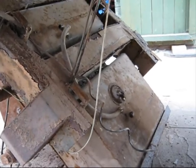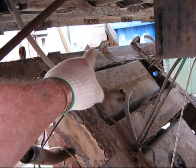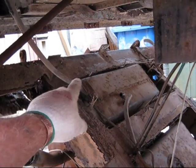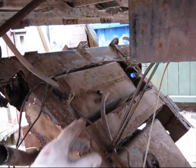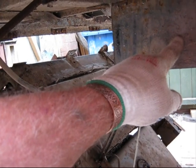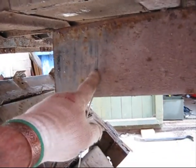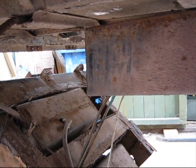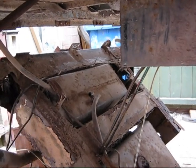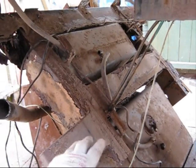But there you see, if I'd have done this differently, I'd have cut the chassis first and then nipped the back ones off where they held onto the back frame. And people might ask, why am I doing this without taking the body off? Well, I want to slip the chassis over and see if it'll locate all up first. Even though it'll sit on these runners and it's fairly straight, I want to be able to see it sit on here, tack it on here, and then remove the body, knowing that when I come to put the body back on, the chassis quarter section will be right. I've got to trim these a bit to get the right amount.